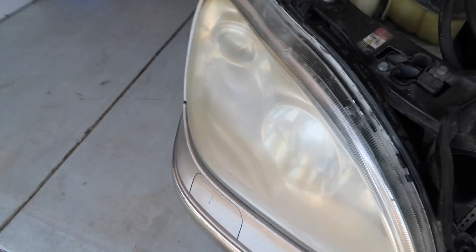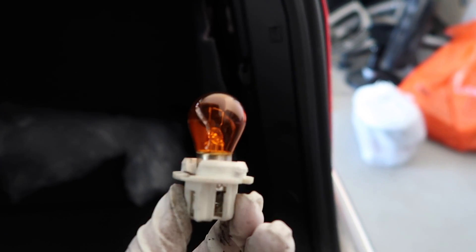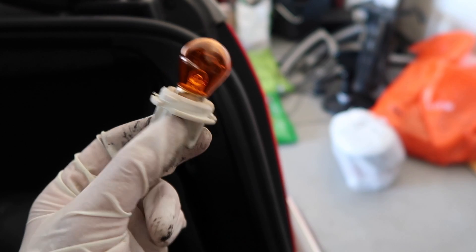And just like that, it's all done. Moving to the trunk of the car, this is probably the easiest one out of the three to change. You don't really have to take out anything — in this car there's a space here you can pull back to expose the board. Your turn signal is going to be this white one right here. You're going to turn it counter-clockwise to release it and then just tug it out. And there it is — there's the bulb. Thanks guys for watching and I'll see you guys next time.